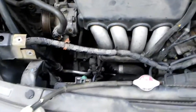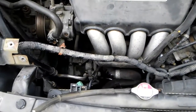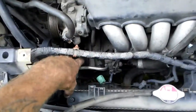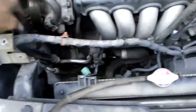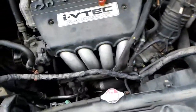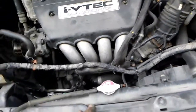It takes way more time to get all the stuff off, so be patient. Remove all your plastics, take your upper support off, remove your fan and your overflow tank, then undo your tensioner and pop your belt off. Three bolts and it's out — it's not really that hard. Don't forget to make sure you have your radio code when you disconnect your battery.